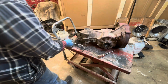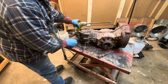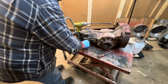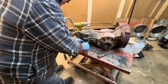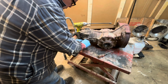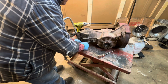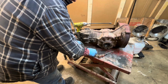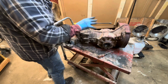We'll take our ground strap off and our rear mount. The front mounts looked pretty good. I think this is the original one, the original mount. And a lot of the times, you know, as an upsell, a shop will say, well, you need new transmission mounts. And they just do the front ones just to do them. And the customer doesn't know he has 3 mounts. So I think that's why the front ones were changed.